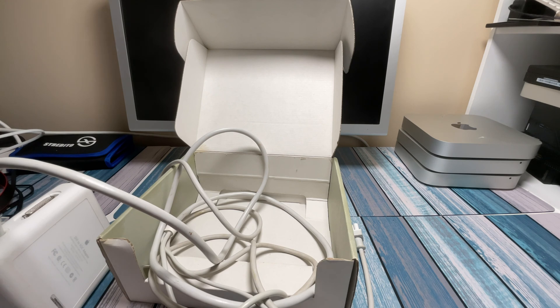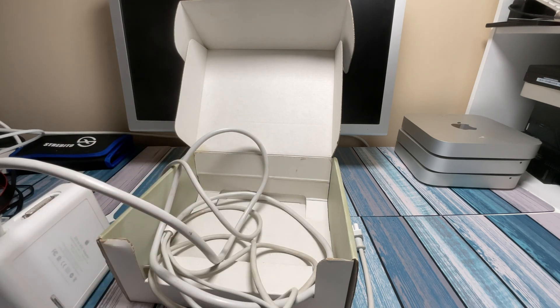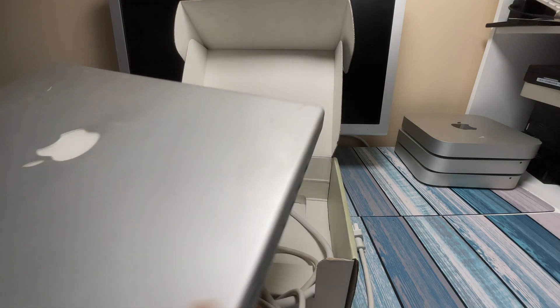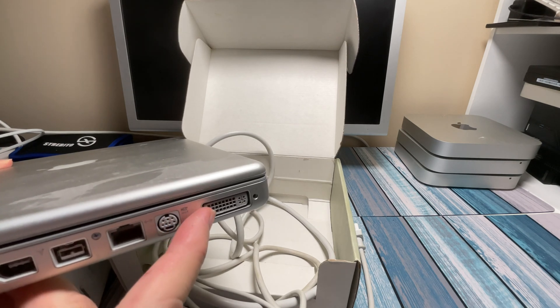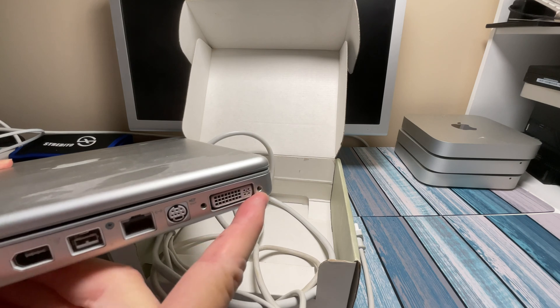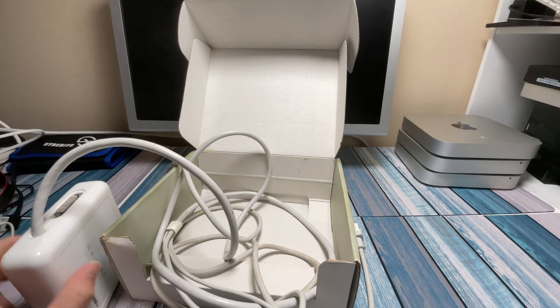Yes, you heard me right — when that first 23-inch Apple monitor came out, it was over $3,000. And it didn't even have that great of a resolution when you're comparing it to today's monitors. But it did have the ability to plug in USB devices into the back of it, which is why you'd need to plug this into your laptop. So here is, for example, a PowerBook G4, and right on the side there we see that DVI connector. In today's world you could just plug this right into a DVI monitor or even an HDMI monitor, but if you wanted to use that fancy $3,000 Apple Cinema display, then you'd have to use something like this to convert it, because those displays were originally only set up to connect to PowerMacs that had the ADC connector coming out of the graphics cards.